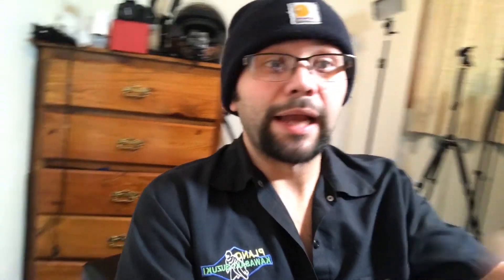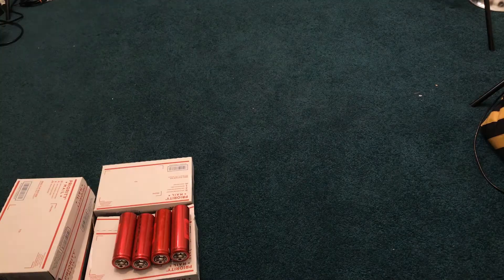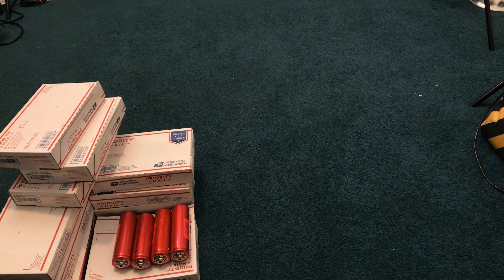So I dug into it, did a lot of research checking out different types of motors and controllers and batteries. There's a lot of stuff I didn't quite understand — I do now — but I got together a parts list, kind of a budget parts list of what I needed. So what you see is what I got. These are going to be our batteries — lithium iron phosphate batteries rated at 200 amps with a capacity of 8 amp hours. Got a total of 52 of these.